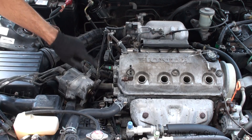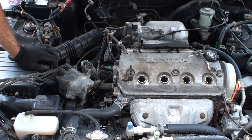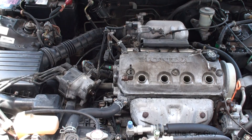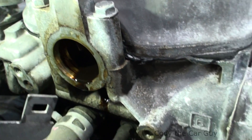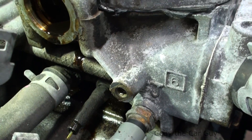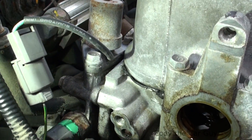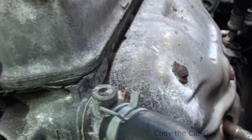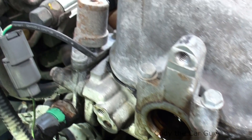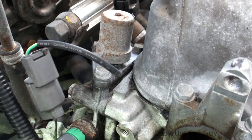One video is changing the O-ring on this right here, and the other one is changing out your VTEC solenoid — call it a gasket, but it's actually made like an O-ring with a little new screen in it. Now that's where the distributor came out of, and there is oil on top of the transmission right there. The way the solenoid is set, if it has oil coming underneath it and gets on top of the transmission, it can also run down the front. We're going to knock out the first one and do the O-ring here, and then we have a new VTEC solenoid O-ring gasket going on it — we'll be removing that next.